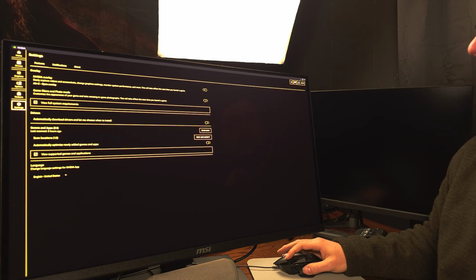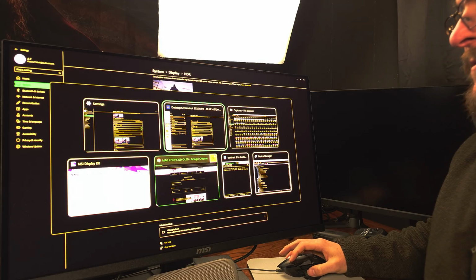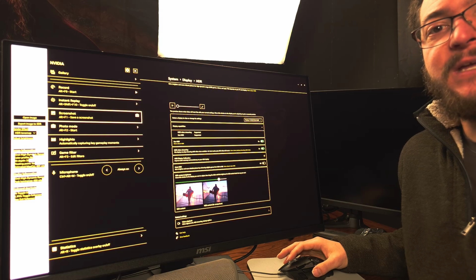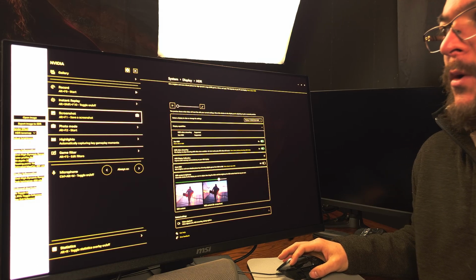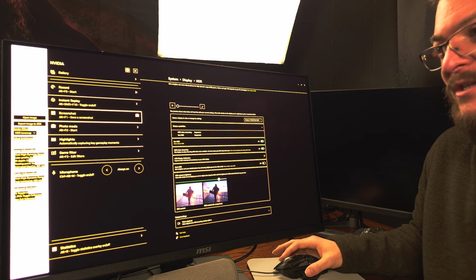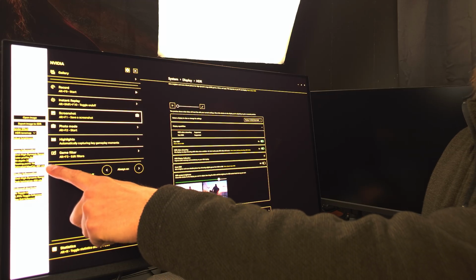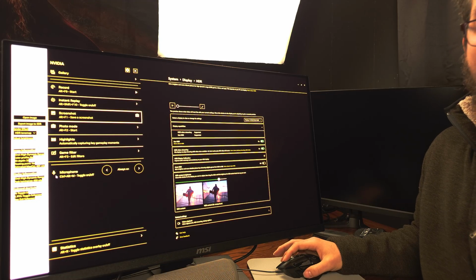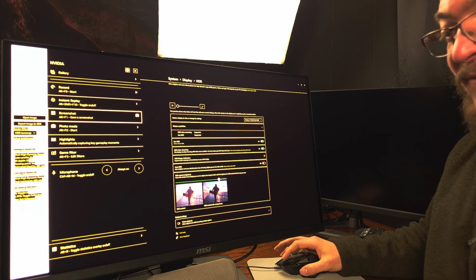go to the screenshot, and you're going to open the screenshot with the HDR WCG image viewer app, which you can get on the Microsoft Store. HDR WCG image viewer app. So with this app, I can see here MaxCLL 401 nits. So that was with the slider at 85%.